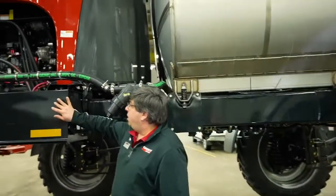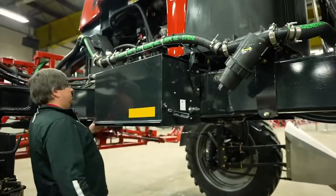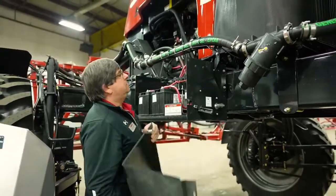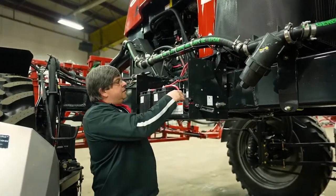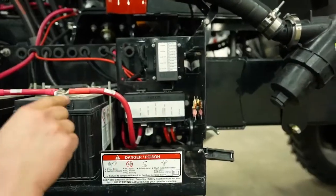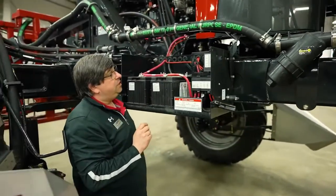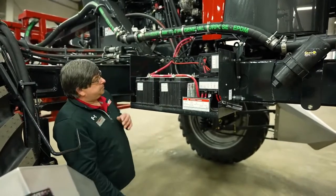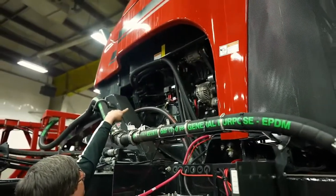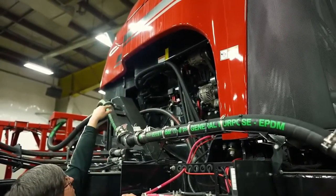Here's our battery box location — there are two latches on there. Inside the battery box is our 60-amp fuse — that's the one that could blow if you boost from the power points rather than the battery directly. Looking up in the engine compartment, there's the secondary fuel filter location, and that's the other location with a bleed screw on top.